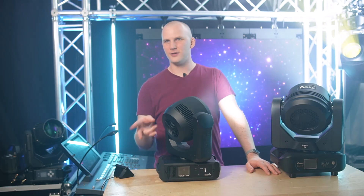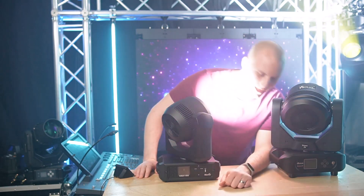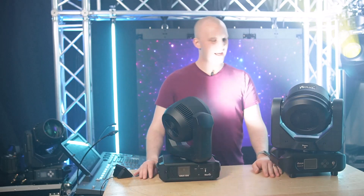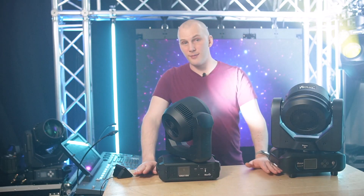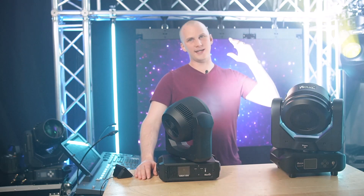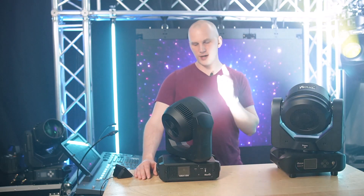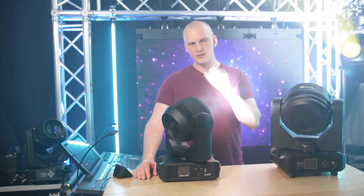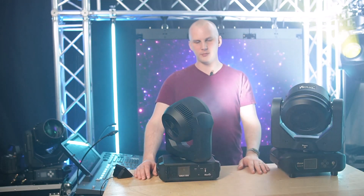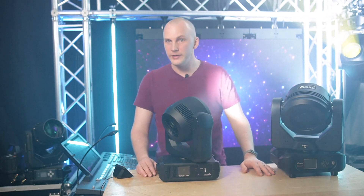Number two in the physical is fan noise. Listening to the Sysma versus the Aera, there's really no competition. When you get both of them with their fans at full, the Aera is significantly quieter — rated at 37 dB — and you can set the fans into a constant theater mode that gets you down to about 31 dB at one meter, which is crazy quiet.